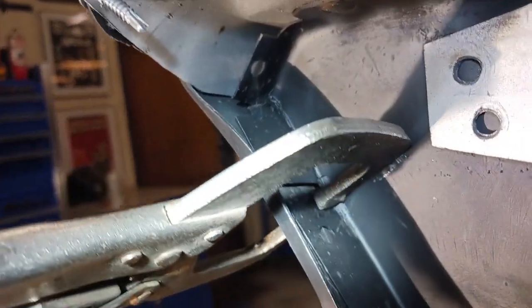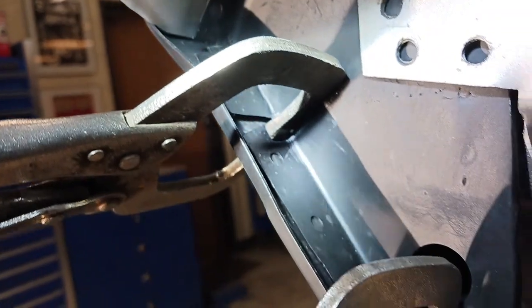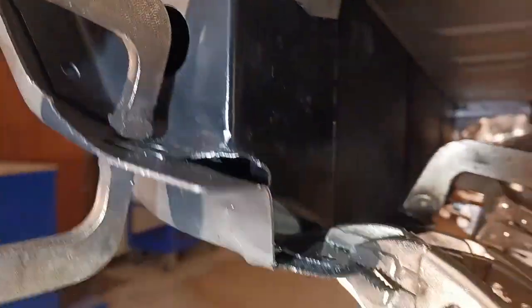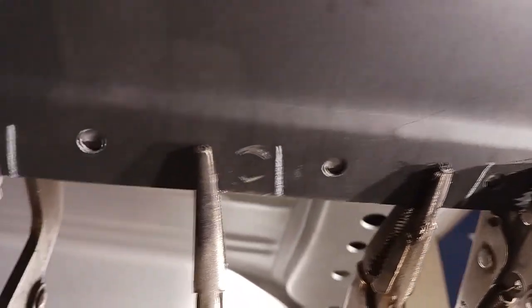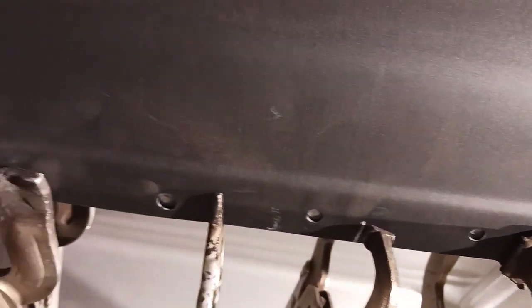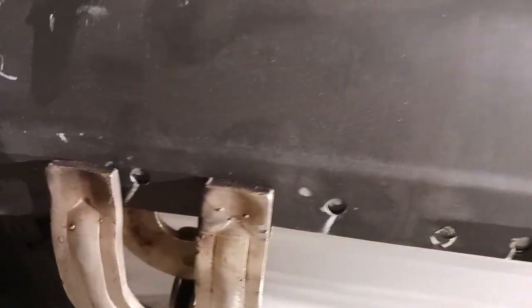Now I'll tell you where everything is won and lost. The clamps are just to hold it in place while we weld, to hold the metal tightly in place so nothing moves. You can see on the flanges, there's not a lot of hammer marks. It's not bent up. The fit is everything. We want the two panels that we're going to weld together to lay together like a blanket on a sheet on a bed. We don't want to have to force anything. If you do the prep correctly, you're going to get really nice results.